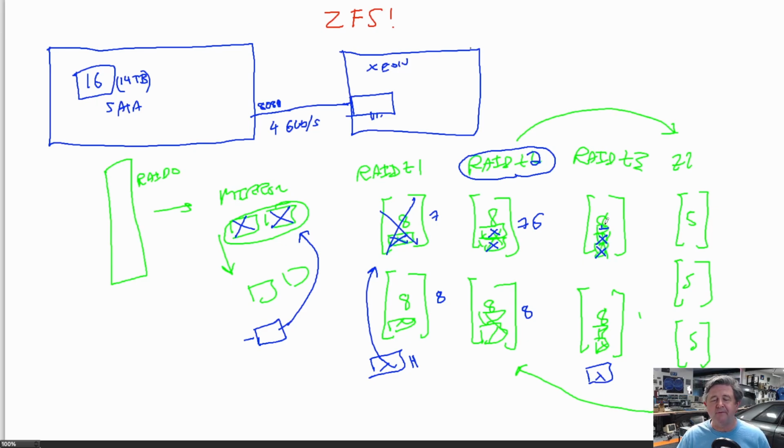And so it's something to keep aware of when we're building these arrays, that in general, you'll find RAIDZ1 is not going to be used much for this. And RAIDZ2 offers a really good compromise between the performance you can get and the reliability, particularly if you can get to the machine at some point and replace a drive. So that's sort of the concept.